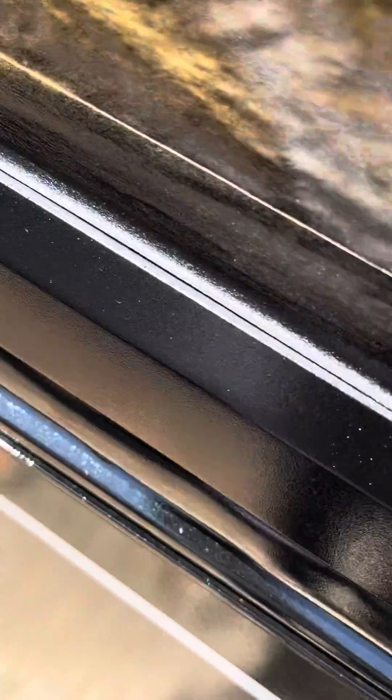There are a couple other things you might notice. Right now it's probably about 80 to 90 degrees outside. You might ask how can you paint with these materials without them drying on you. Well, the thing is you're moving pretty fast, so I'm getting everything really wet to look like a mirror. That's one of the things you've got to do — make sure that it's really wet.